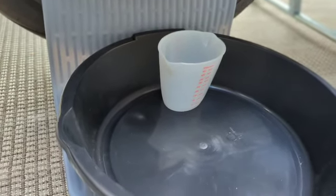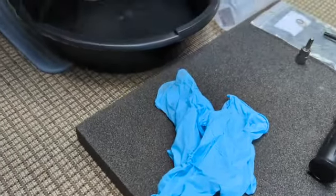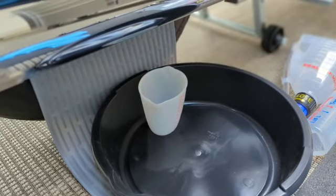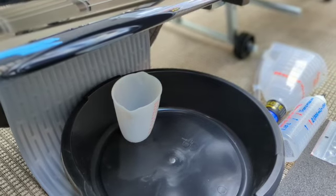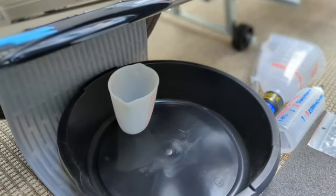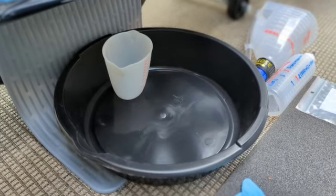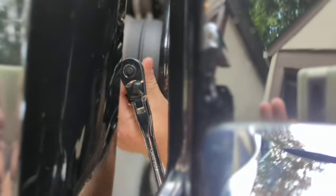I want to capture the fluid just to measure what was actually in there. I've got the pan in place, and when I pull the drain plug I'll be putting on rubber gloves. Let me get the fill plug out first — that's important. Before you drain anything, make sure you can get the fill plug out first, because if it's stripped or torqued and you can't remove it, you can't fill the drive once it's been drained. Then you're being towed to the mechanic rather than riding.